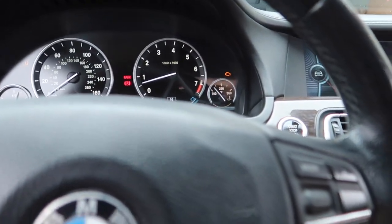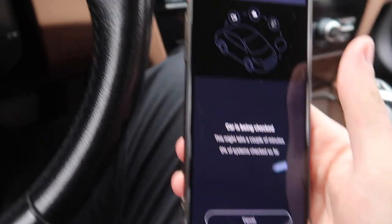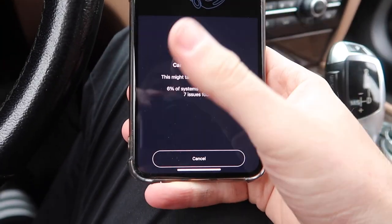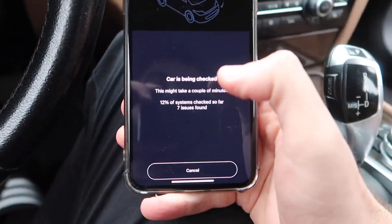Anywho, we're gonna go into Carly real quick. They went up in the rear doors. So for now, let's just go ahead and hope to God our DMTL pump is working, and that we have no more issues there. So we're gonna go ahead and clear the lights and pretty much rescan the codes. If the DMTL code is no longer there, we are in business. And if it's still there, unfortunately, we're gonna have to do a lot more diagnosing.